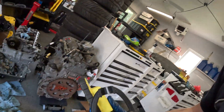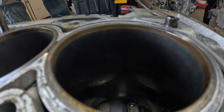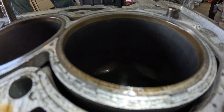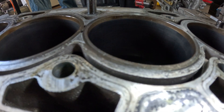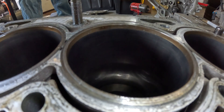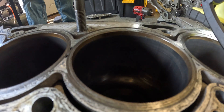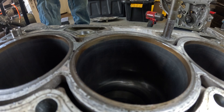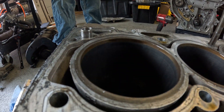So what is it and why? Now we'll look at the cylinder walls. Cylinder wall number one — it's really hard to catch this on camera. This is the intake side we're looking at, and it looks really good. Cylinder number two, pretty much the same thing. I do not see any marks visible. There's maybe a little bit of streaking. Maybe that was scraped from debris, but it's really faint. There's nothing that indicates the rings were having pressure against the cylinder wall.